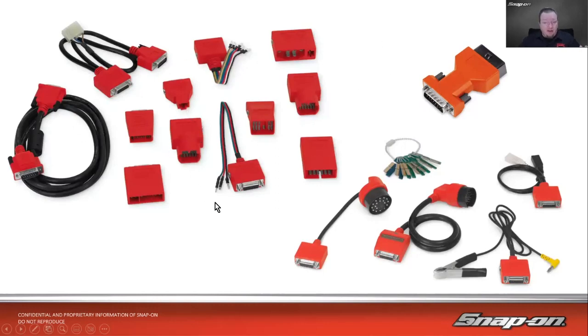So back then, pre-96, pre-OBD-II, it was really the Wild West out there. The manufacturers could have any sort of pin configuration they wanted, and there really was no rhyme or reason to it, which is why OBD-II really helped us, at least in that aspect. I don't know if it helped anywhere else, but it definitely helped in having a standardized connector, standardized protocols, and standardized codes that would be the same from manufacturer to manufacturer by and large.